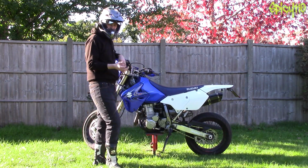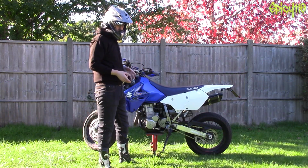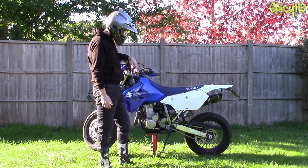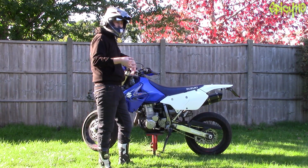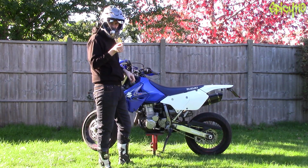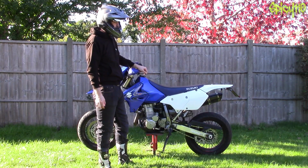If you haven't got enough slack there, because I've seen people who've adjusted them to like an iron bar, when they get on it, it's going to be doing huge damage to the bearings and putting a lot of excess strain on the chain. You want to make sure there's enough slack, which is within spec for that bike, and then test it with you on to make sure that it isn't going solid. It needs to be just a little bit of movement when you're sat on it. But as I say, you'll find a video on that for your bike or your instruction manual.